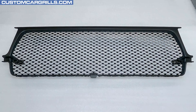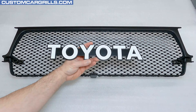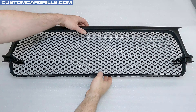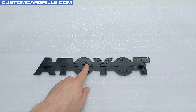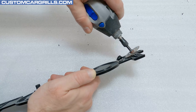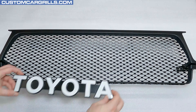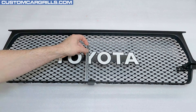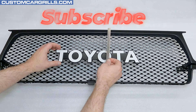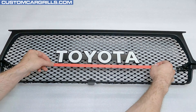Back to the grille that we've been working on — while this plain grille looks amazing, I want to take it to the next level with a retro Toyota emblem. This will look especially good for late model builds. In order to install the emblem, there's a little modification needed. On the back of these emblems, there are three mounting studs — these don't line up with anything on the mesh and aren't practical to try to use. These mounting points will need to be cut off, and the Dremel along with the cutting wheel is a great tool to use for that job. Once the emblem is flat on the back, I'll try to eyeball getting this thing centered up, then I'll grab a small ruler and start to nudge it back and forth until I have it equally spaced top to bottom. Let's go ahead and mark that with a piece of tape to preserve the alignment.